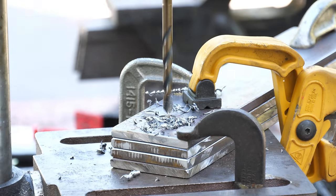And we'll go ahead and take care of the mid-car exhaust mounts. With the help of a thin stainless washer, new isolators, and redesigned bracketry, we'll get the U-bolt back in place on the pipe and tighten everything down. The bracket on this side needed a bigger change and an extension. So I kind of just folded over one of those trans-cooler mount straps because I didn't really feel like doing anything else. The passenger side was much more straightforward and only required a bit of bending before it all went together. That about finishes up the exhaust, and next time we should be finishing the suspension.